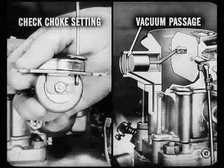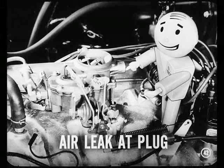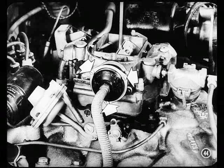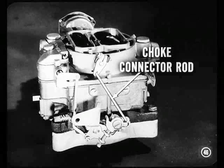What would you do if the choke were not wide open? Well, I'd first check the choke coil setting — it may be too rich. Besides that, the choke vacuum passage to the piston may be partially plugged by foreign matter, or there could be an air leak at the plug in the end of the vacuum piston cylinder, preventing full vacuum being applied to the piston. You can test that by smearing some oil on the plug — if it's drawn in around the plug, you know there's a leak; in that case, replace the air horn. On four-barrel carburetors, be sure the screws which hold the choke housing to the air horn are tight. After getting through with the choke, see that the fast idle adjusting screw is off the fast idle cam. If that fast idle screw isn't off the cam when the choke valve is open, check the linkage for binding and check the adjustment of the choke connector rod.